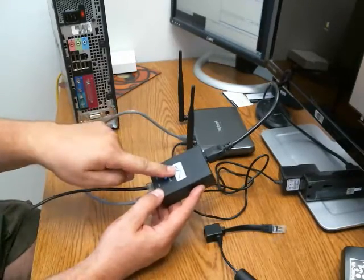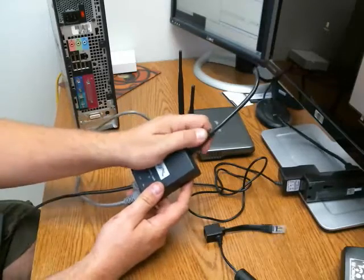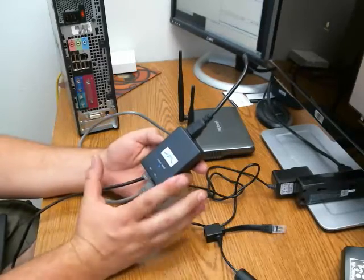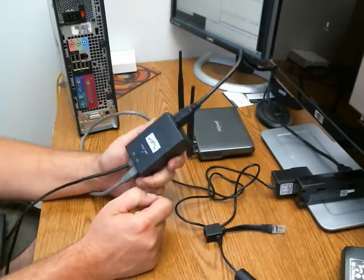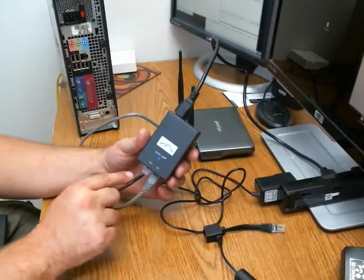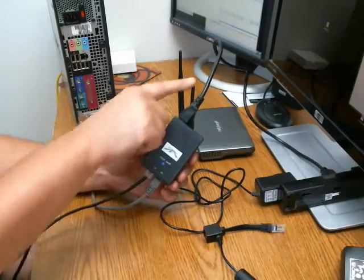The key is following the cable that comes from the antenna. The device that it plugs into is your internet power supply, or your PoE — Power over Ethernet — injector. It may look like this; the size and shape doesn't really make any difference. You're typically going to have three cables: one going to your computer or router, one going outside, and one going into power.